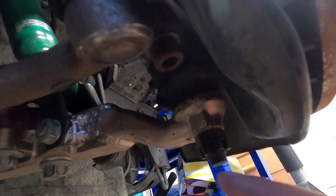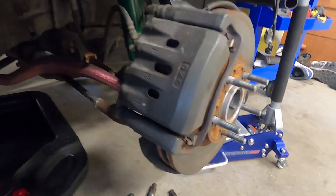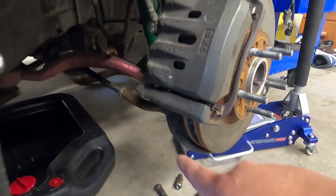These aren't in any specific order, but the next thing you should do in your first few months is your suspension — specifically the front suspension. The lower ball joints are super crucial, especially the way Toyota designed them. They are known to snap with old age, so make sure you swap them out for at least an OEM equivalent. While you're at it, do the toe arms, tie rod ends, and maybe the tension rod. I did every bushing in this area — tension arm bushing with SuperPro, lower control arm bushing with SuperPro, Mevotech uppers, and OEM lower ball joints. You don't want to snap a ball joint on the freeway and crash.